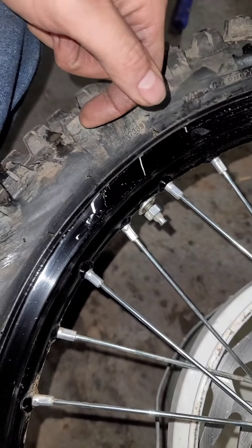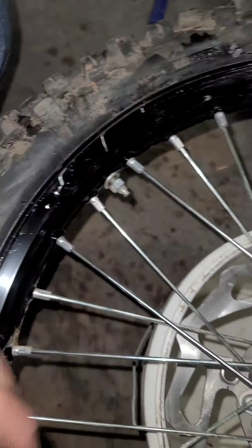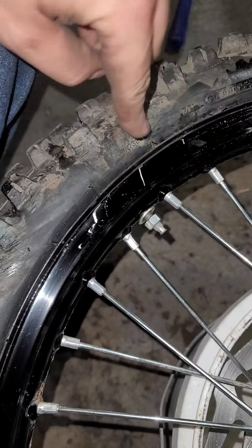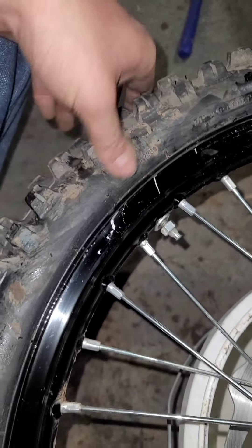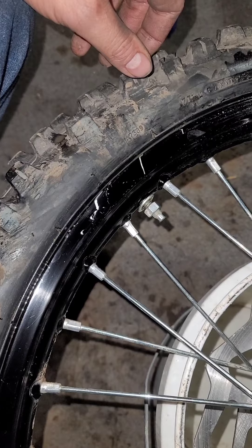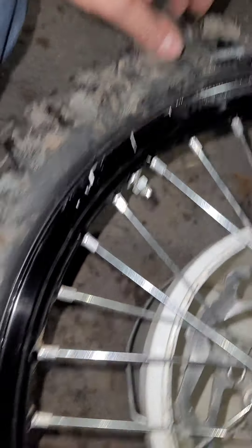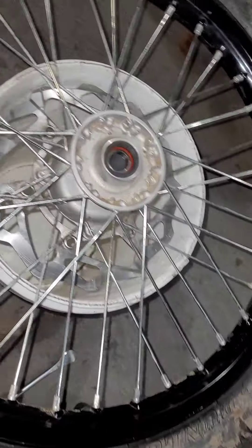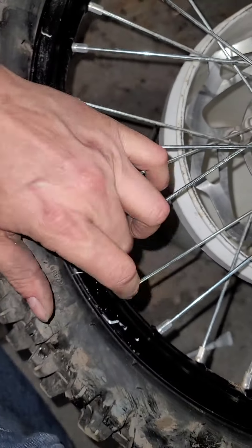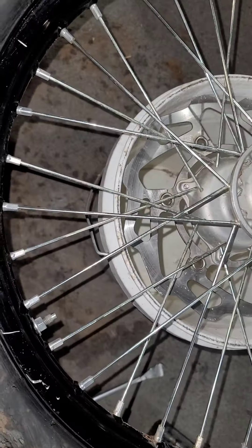The hardest part is the beadlock. Once you get the tire all the way around and try to get the beadlock pushed in, typically with a tube there's no problem since you don't have any air in the tube. But with the bib in there, it's rock hard, so trying to push this in is tough. I fought it and fought it and fought it, but finally got it. Now I can tighten up the beadlock, slap a rack on the bike, and whoop whoop.